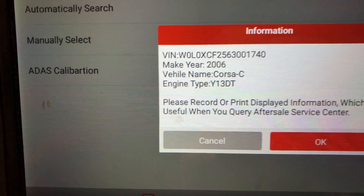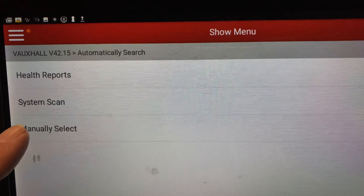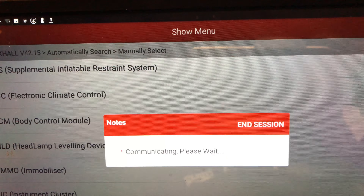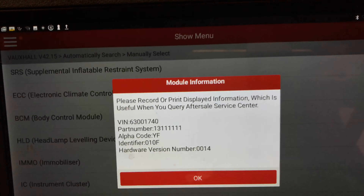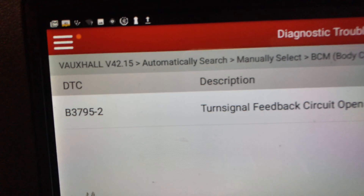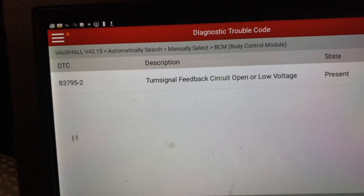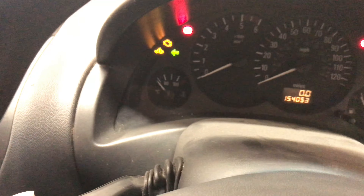So these I'm sure are controlled by the body control module, so we'll go into that — go to body control module, look for diagnostic trouble codes, read fault codes. So you can see it's a B3795-2: turn signal feedback circuit open or low voltage. We'd agree with that — that's like an open circuit, because that's usually what that turn signal would signify, because it's flashing rapidly.